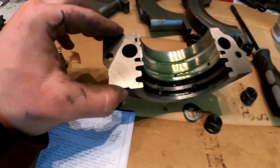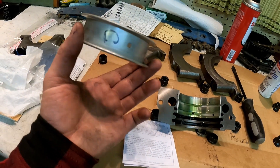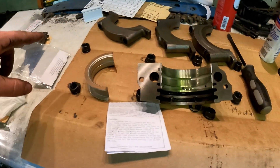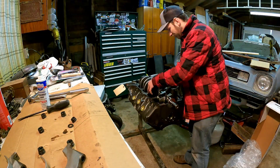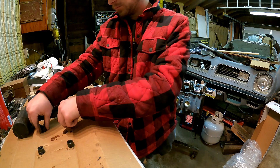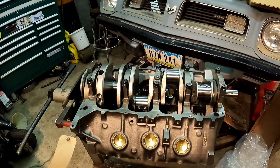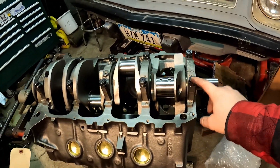Main caps are going together exactly the same way. We're just pressing in those bearings, which are already numbered. The thrust bearings were labeled cap and bottom since they are identical. I did fill in those two anti-rotation holes with some oil-proof silicone just to hold that Viton seal in place. We'll go ahead and do caps one through five and then torque the main caps. And there you have it — one crank in a 455 block that's about to be 474 cubes.